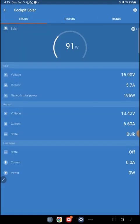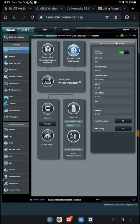So now if I go back to this, notice it already says network cable is unplugged, and now the secondary will go out and show disconnected, and it's got to go through the DHCP cycle for it to work. So that was the first try, but now boom, it got the address 192.168.150.180, and it's up and connected. It just amazed me. That was so easy, and I didn't do anything really other than plug it in and turn it on, and it just worked. So just awesome. And I've got it set to fail back.